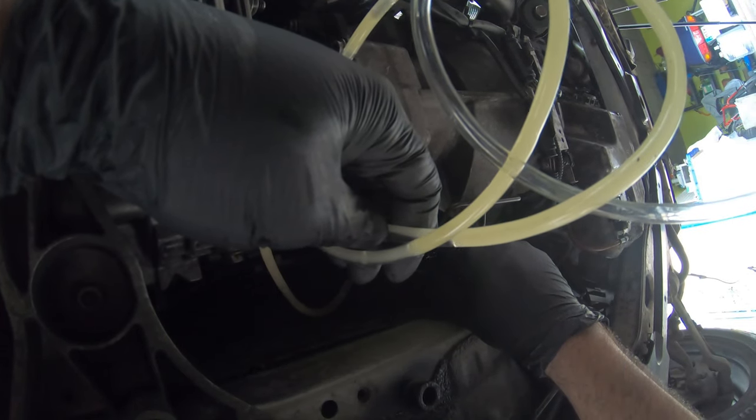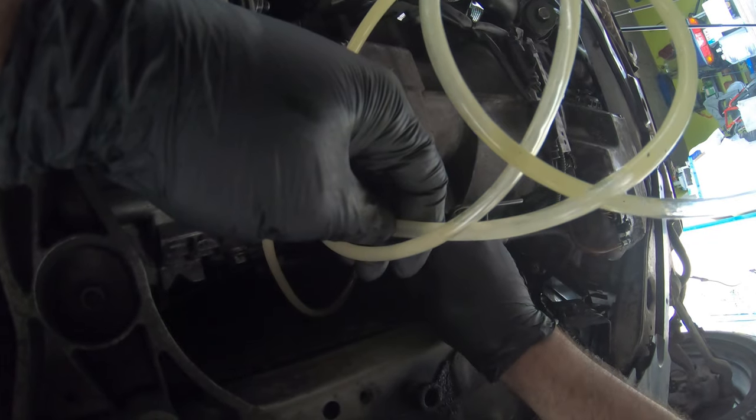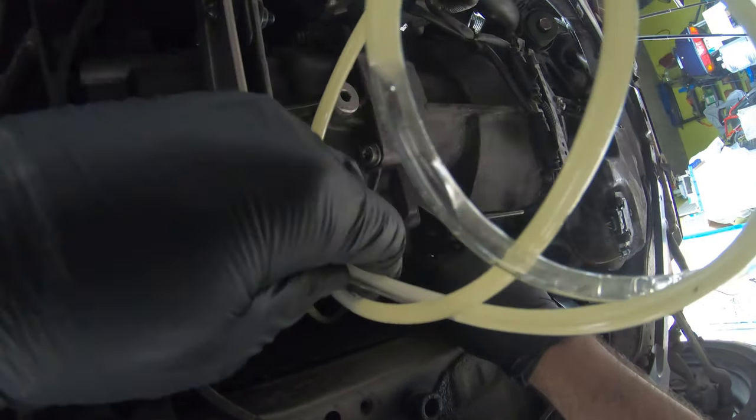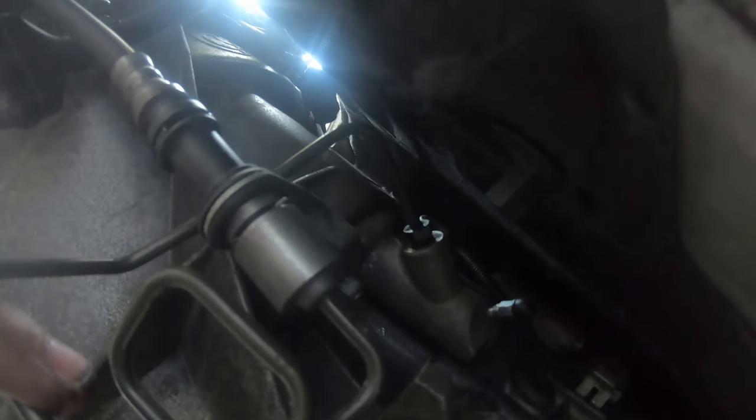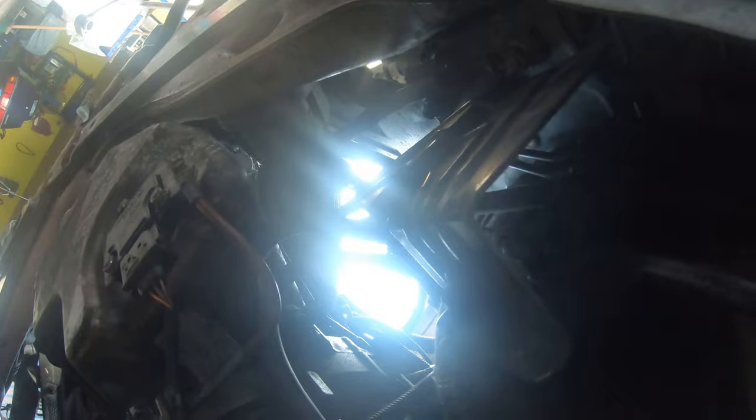Can you pump the clutch? Does it feel better? Does it feel normal? One more time — can you push the clutch? Alright, that looks clear. Double-check your exhaust is tightened up, shift linkage front and back, drive shaft bolts, transmission mounts, the mount for your exhaust, the slave cylinder, the mounts for your oxygen sensors. Make sure everything's plugged in, make sure the grounds are plugged in, plastic covers back on and the exhaust is bolted up. That's everything underneath the car — now we can move to the top.